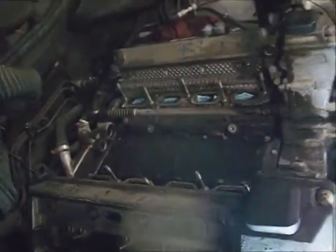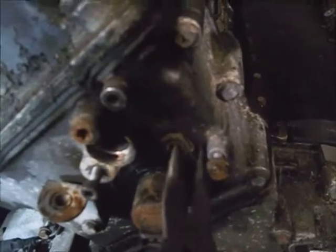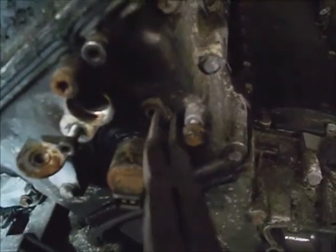Now I'm going to pick this whole mess up and lay it up there on the cowl and bungee cord it back. I went ahead and took the four 10mm bolts out of these seals around the cam solenoids — just four of them. I sandpapered off the rust and sprayed some penetrating oil to help lube this seal up coming out of there.